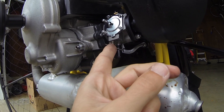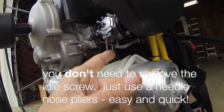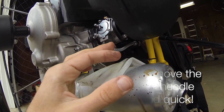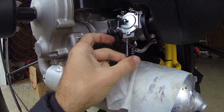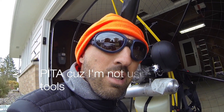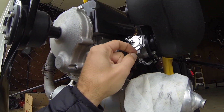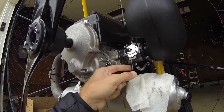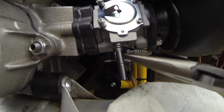Alright guys, I'm having such a hard time getting this throttle cable in, so I'm just going to remove the idle adjustment screw. I already know what my setting is, so I'm going to remove it all the way, put the cable in, and then put the idle screw back in. And now I can get it much easier — though this thing is still a pain to get in there. I texted my friend Scott. He said to bend this little metal flexible rod thing and then use pliers to kind of pull it through. I've got a needle in those pliers — I'm going to work it through with this thing.